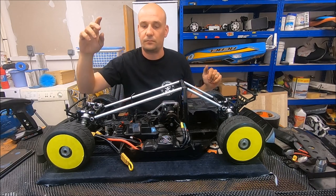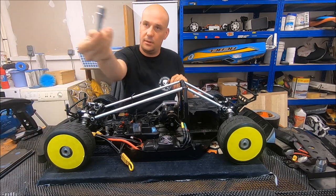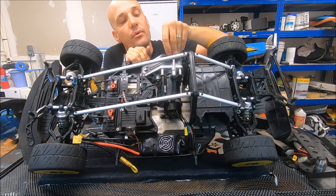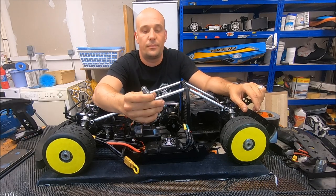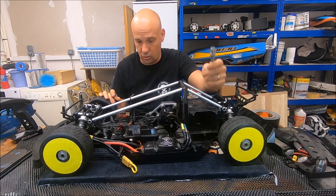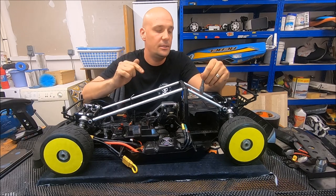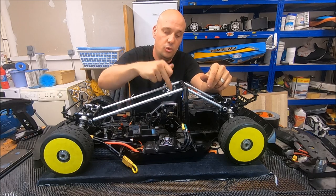To put this motor in the original MCD X4, there's an axle that goes on the motor axis and onto the gear, but the stock adapter is only made for an 8mm motor axis. This motor has a 10mm diameter axis, so I had a brand new adapter machined with the help of Rivierport in France.